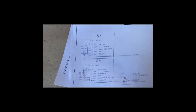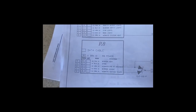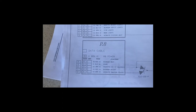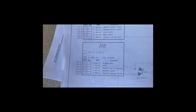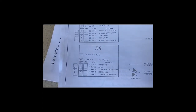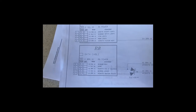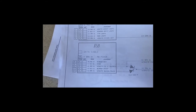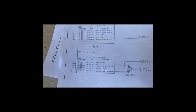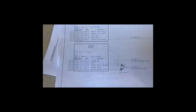In a Marathon, R8 is the Webasto ignition solenoid. This sends the signal to the relay marked RWI and turns that relay on and off. Really what those relays are controlling — like any other relay — is something that has high amperage to it. So R8 turns the relay on for ignition, which sends a signal to the RWI relay, and that's going to turn on the solenoid valve marked RWI that I showed you earlier.